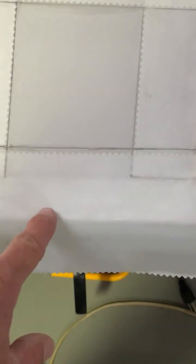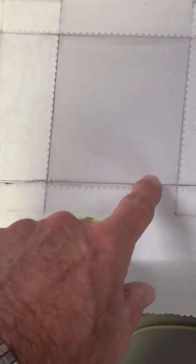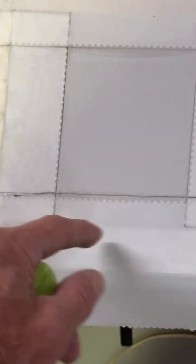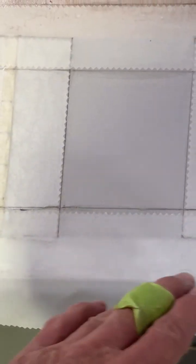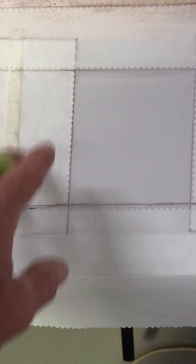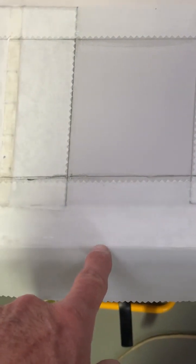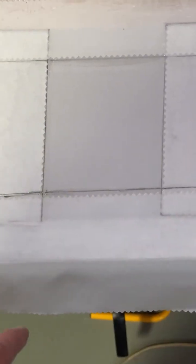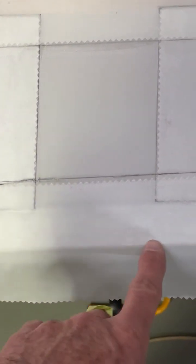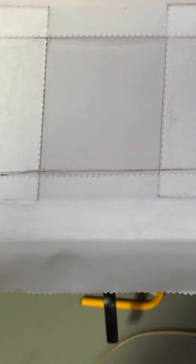You could, in this situation, like I've done before, mark a 2-inch and put a 2-inch here. You put your 2 coats of thin down, put your coat of thin, put your tape in it, put a coat over, another one on top, just like you do normal tapes and everything. Your pinked edge would be right here at the trailing edge, and that'd be totally fine. When you put 2 to 3 coats of primer and sand it, you really won't ever see that. That is probably the fastest way, because you just lay a 2-inch, do it to the other side.